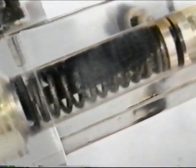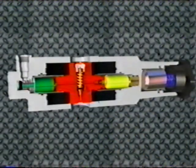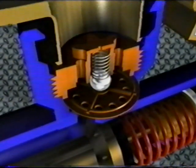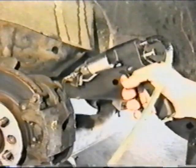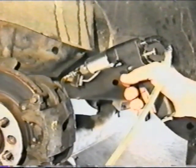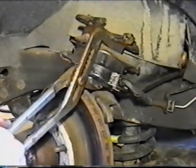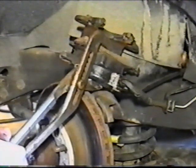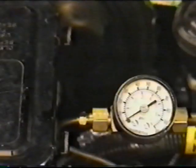Some technicians are concerned about the possibility of pushing contaminants upstream to the brake valving, ABS modulator, or master cylinder during RFI bleeding. Phoenix has had extensive research done in this area. The main difference between the RFI process and that of pushing caliper pistons back in without opening the bleeders is the pressures being produced and the amount of fluid movement.